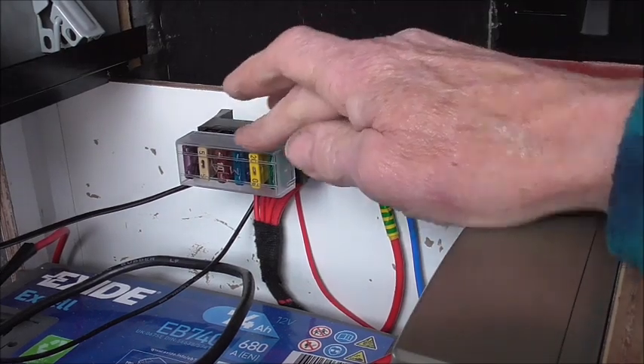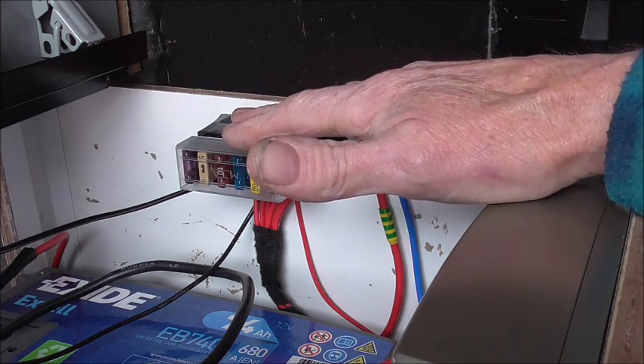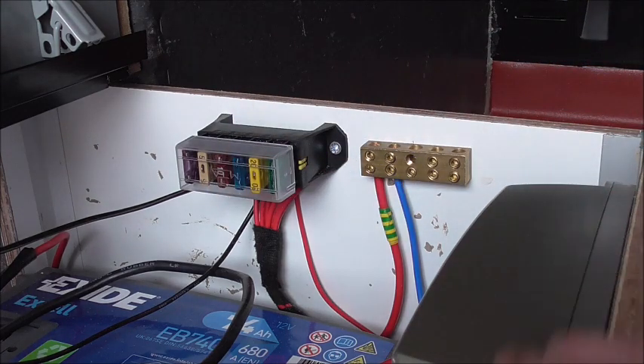Having the auxiliary fuse box here makes it very convenient for running other things. Like the LED lighting circuit, which is run from here. Other things you may want to do you can run from here without affecting your main battery, so you can be running them all the time — it's just a useful addition. The main aim of it all was obviously for the 240V charging of my power tool batteries, which is what I've accomplished. So that's how I put in a 240V system for a vehicle that's got a smart alternator, connecting up a DC-to-DC charge system.